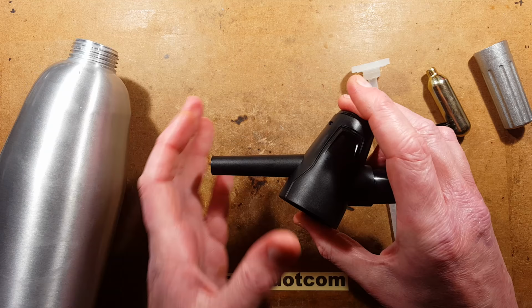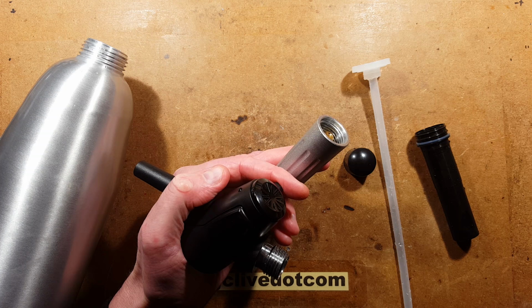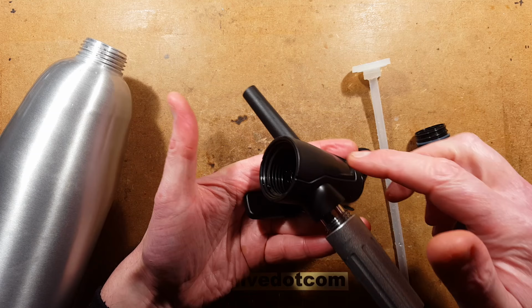It has to take good pressure because it is pressurized with carbon dioxide. And the pressurization is done with this. You take this cap off, you pop a Sparklets capsule in, which holds 8 grams of carbon dioxide. You pop it into this, and then when you tighten it up, it will actually inject the carbon dioxide into the bottle. I'll do you a doodle of how this works.